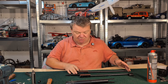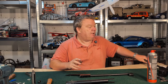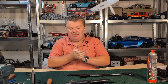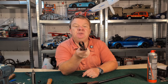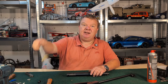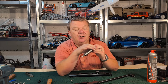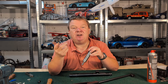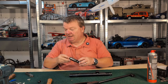I have two barrels in front of me because this gun has a 177 and a 22 barrel. I'm refitting the 22 because that is my preference, so I'll put that one to one side. I've got my compression tube here. I have already degreased and deburred my compression tube — it is ready to be put back together. Here is my piston. It has been cleaned, degreased, I've removed any weights and washers from inside it, and I've polished the piston with approximately 160 to 180 grit abrasive, then approximately 240 or finer abrasive, and finally metal polish. He is ready to go in.